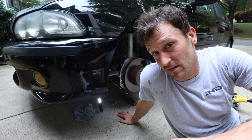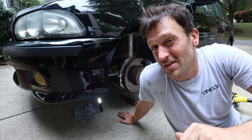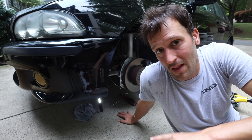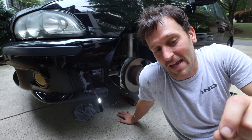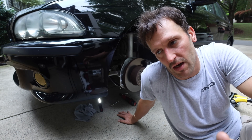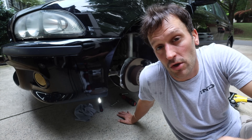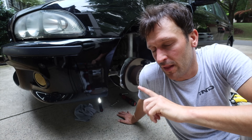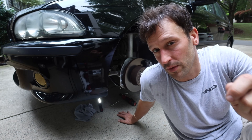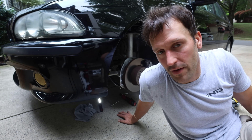While test fitting my new wheels, I pulled out the wheel speed sensor on the right side and noticed a lot of brake grease on it. Whoever did the brakes last used too much brake pad grease, which can clog up the journals and the sensor itself, prohibiting it from reading the rotational speed of the wheel. That would explain the intermittent behavior — the grease just moving around. There was a lot on the right side and a little on the left, so I'm cleaning out those journals as best as possible before spending money on a new ABS unit.